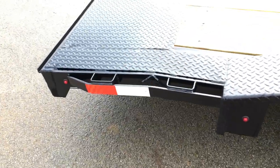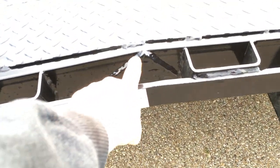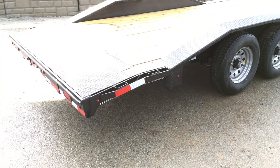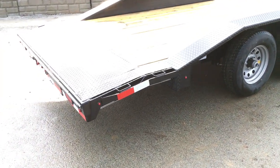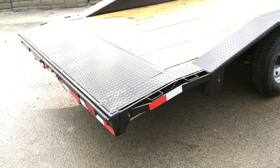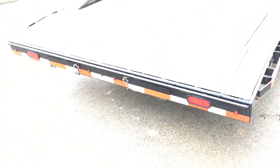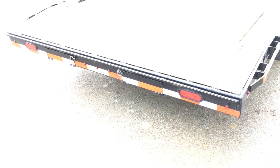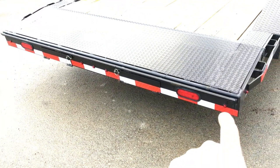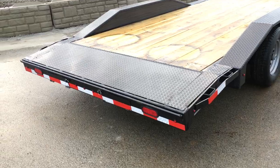Moving to the rear of the trailer, you have additional tie-down points with your stake pockets and rub rail. Another thing you wouldn't often see is a gusset on the beaver tail. Many manufacturers, even up to 14,000 pound GVWs, don't put that gusset plate on — but they do here even on a 10K trailer. The trailer has all LED lights, and also an extra side marker that isn't required. You're only required to have stop, turn, and tail at the rear and three center markers, but they include them anyway. There's also reflector tape on the side and all the way across the back, which isn't required either.